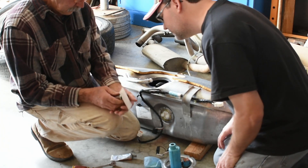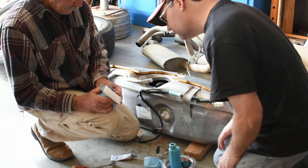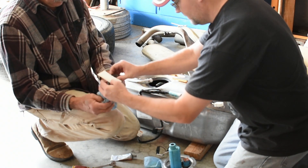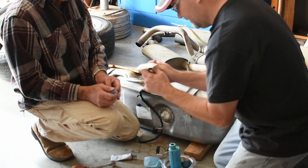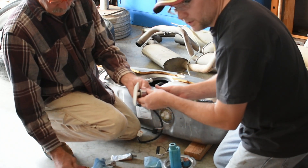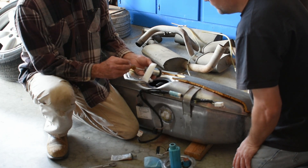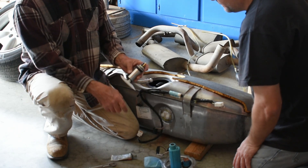It's rotating on us — yeah, it did rotate some. See if you can push it in. My hands are slick. There we go — a lot easier. Once you get that silicone a little bit in, it slides on a lot easier. For your information, the way I got it apart: just stick a screwdriver right here, pry it back, and it'll push it out and then drop it down out of there.